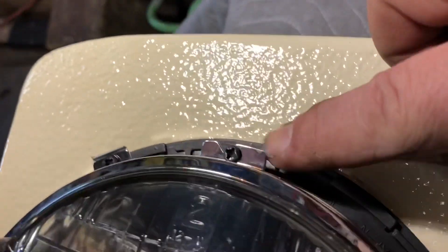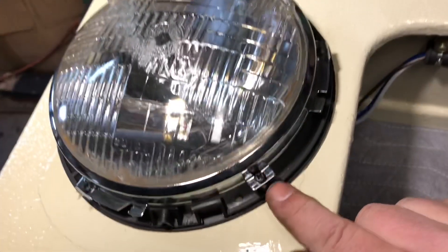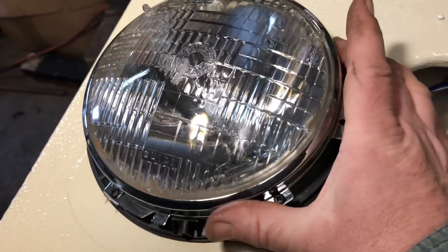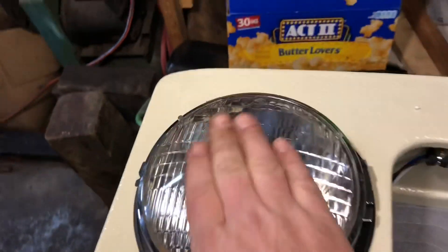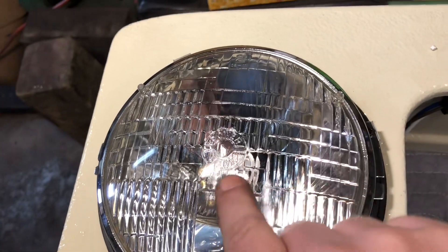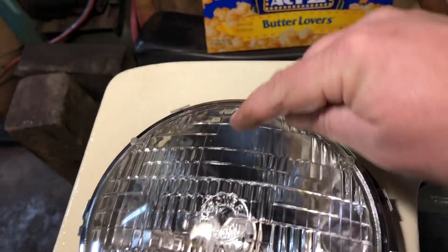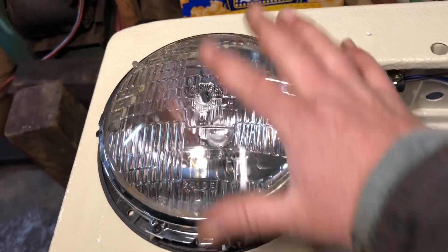Here's the other side — it's in. Make sure you put your little tabs inside the adjusters, a little tricky. The black Sharpie's up on top. This is your pivot point for adjusting the headlight side to side. This screw goes in the whole way so the headlight just floats there, held by three points to adjust your headlight up and down. You can see it's straight up and down the way it should be.